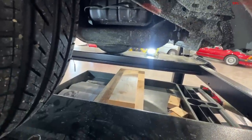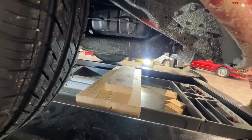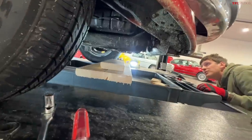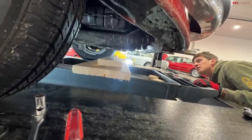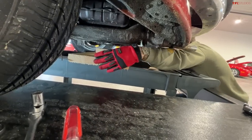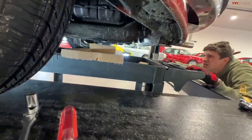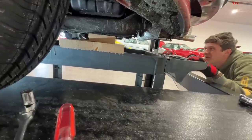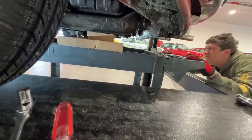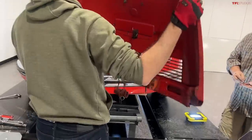Drop it. Beautiful, it's like a dream. You can see the fan shroud, and in that hole you can kind of see the little bolt that we need to undo. We ended up removing the deck lid just to make access a little bit easier. We got three of the engine bolts out perfectly, but there's a fourth one which appears to come in from the front of the transmission. I'm installing one of the bolts back onto the engine mount just so, when we lift the car up to take that one out, it doesn't fall on our heads.